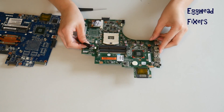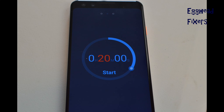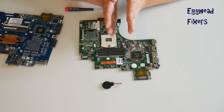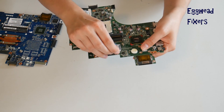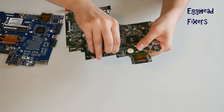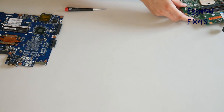Now that you've done that, go ahead and set your CMOS battery and motherboard aside for 20 minutes. This amount of time will reset the BIOS. Once that time is up, it's that simple — you've done your BIOS reset. This fixes a world of problems, including the ones we mentioned at the beginning of the video. Go ahead and plug it back in gently, just like you did, and now BIOS is reset. This will oftentimes remedy the problems we mentioned.